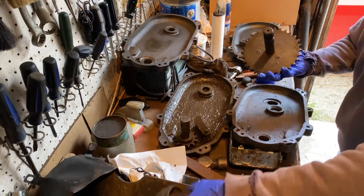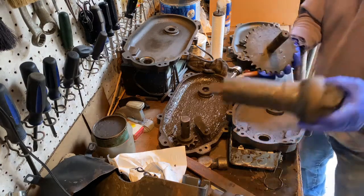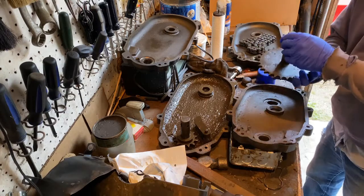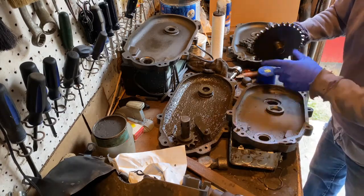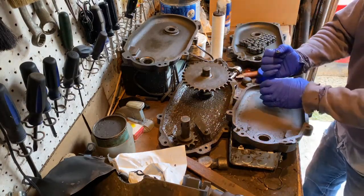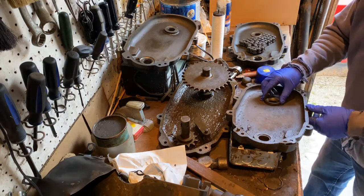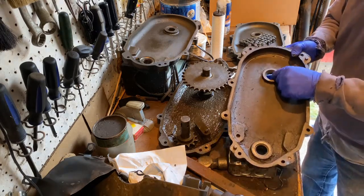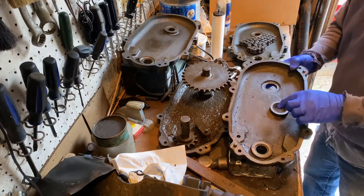So that was plugged in, this stuck out through the other casing and this would lock on. What happened was that someone had the rototiller top arm so tight that it was actually putting pressure on this, forcing this at an angle which ground the bearings down because the shaft was being pushed at an angle. So it just tore them all up and in the process this hole got oblong.